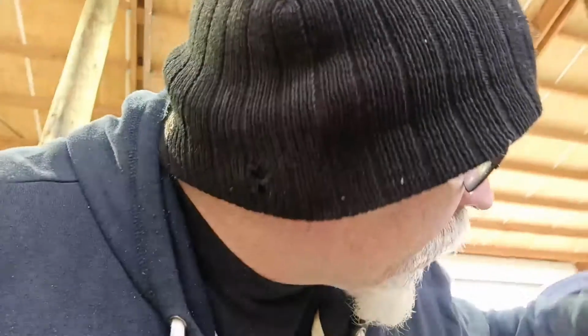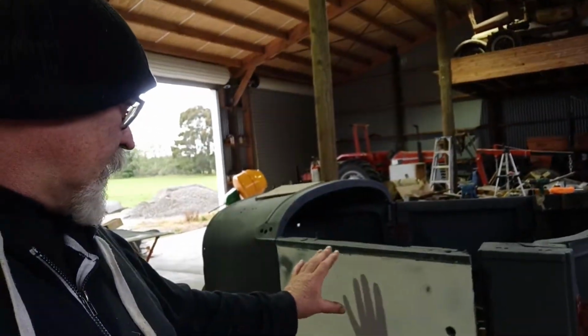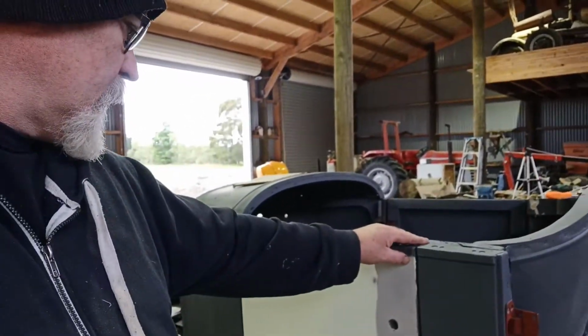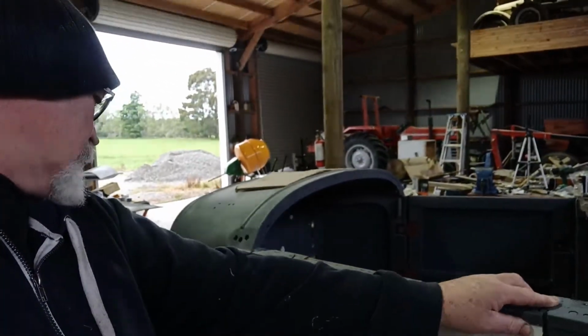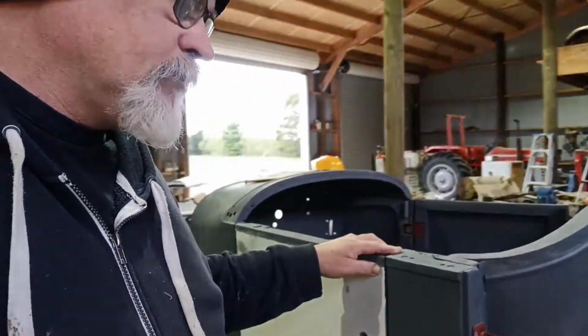So I'm going to get this one to move back. Backing up a little bit at the bottom. So I need to space that hinge at the bottom a little bit more than the top one to get it to come back and up a little bit at the bottom just to get that gap lined up. It probably wants to come back about a mil at the top and a couple at the bottom, which will bring that round. I haven't fitted that, not even going to worry about that one at the moment. Let's get the rest fitting and then we'll come back to that.